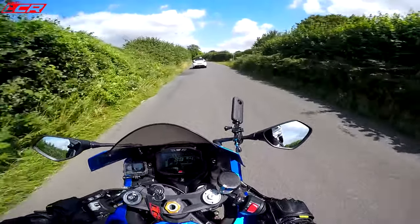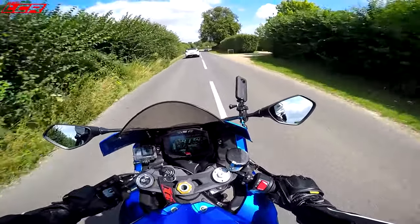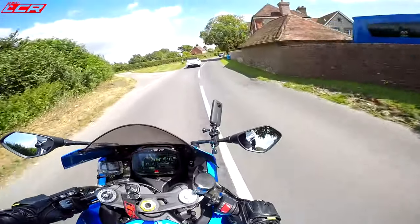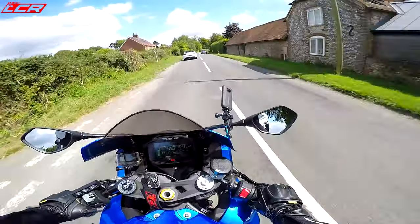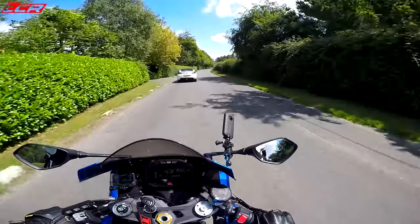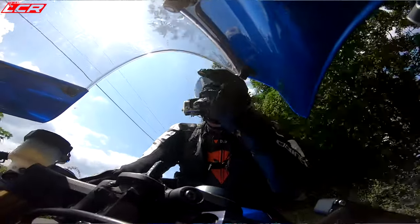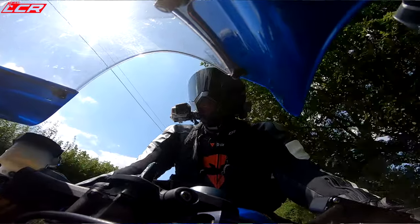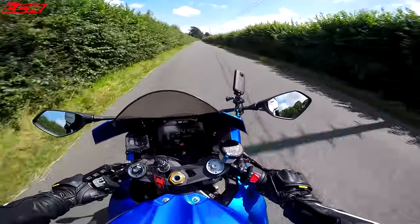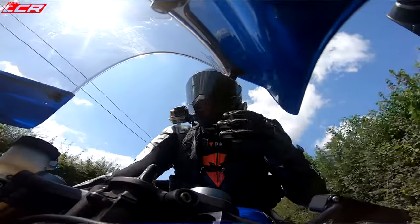First of all, the remapping. It had the Hilltop tune on it originally — I'm not going to get into Hilltop right now — but I wasn't happy with how the bike was performing with that tune when it had the full system on it. It was very snatchy and felt lean. So I took it to be remapped. There's a video up on that. I managed to get 204 horsepower at the rear wheel with the Predator system on it. The bike was seriously lean when it came in, and that snatchiness is all gone.